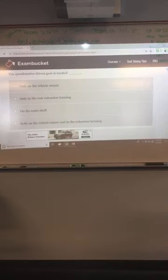If it's talking about the sensors to check for the speed, those are on the right behind the calipers and the drums. Speed sensor. That's what I was thinking, yeah. This is for the speedometer? That's going to be on the output shaft of the transmission. It's going to have a drive gear there. The driven gear is going to be most likely on the sensor. Yeah, and that's what I was saying. The driven gear is what's confusing me. So the little sensor?